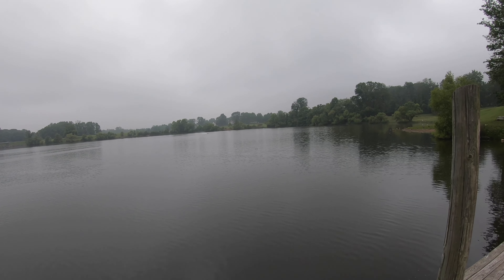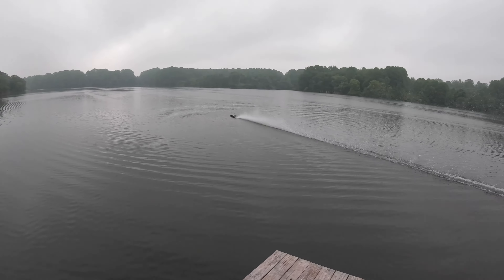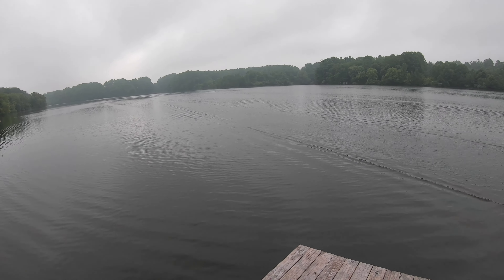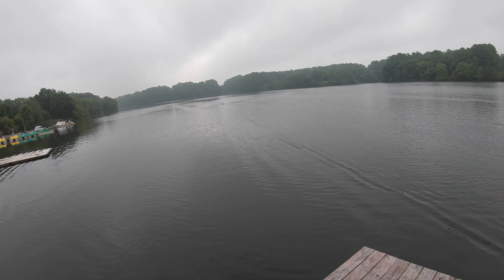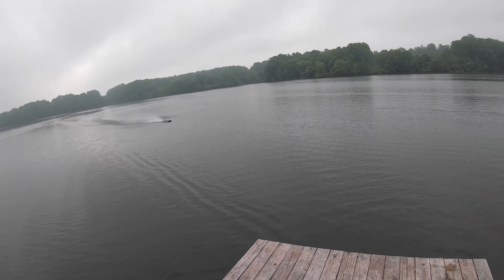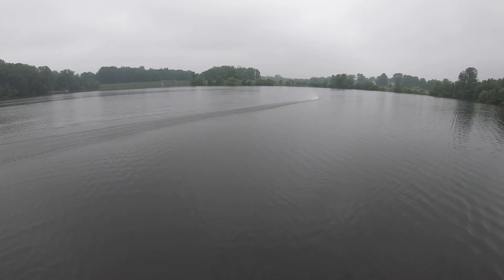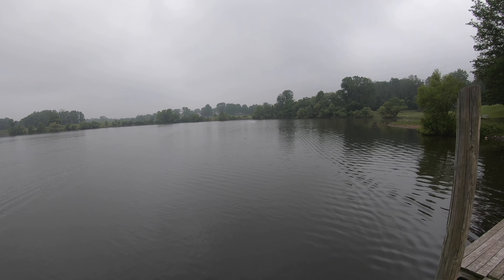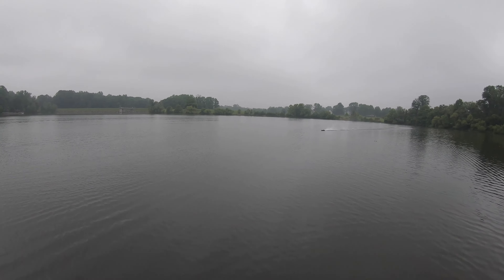Nice long wide open run. One thing I did notice: with the batteries in a regular position and with the struts in the stock position, on a 45-19 prop she will flip. And on the blue high-rake — believe it's the 45.7 high-rake prop — she likes to flip as well.